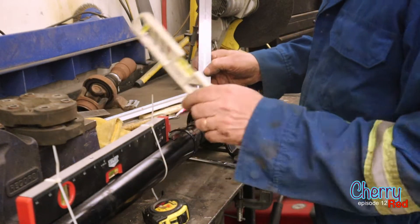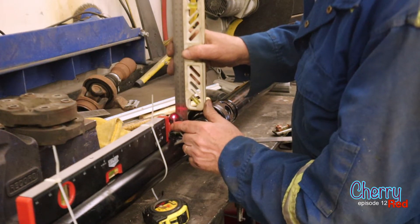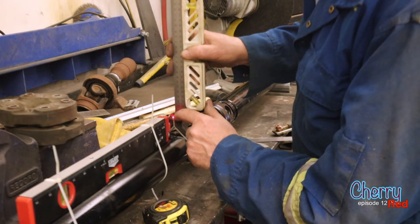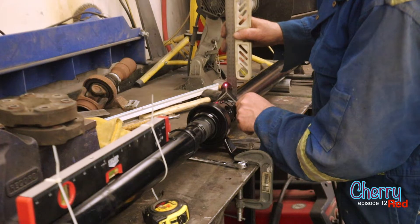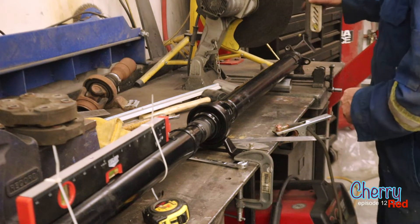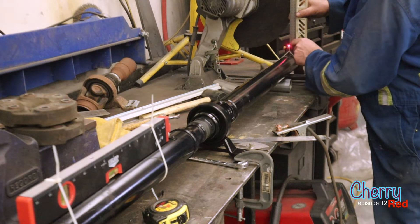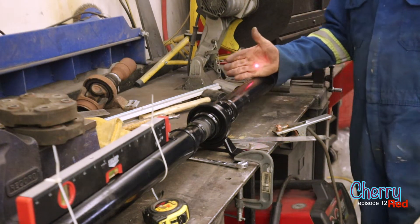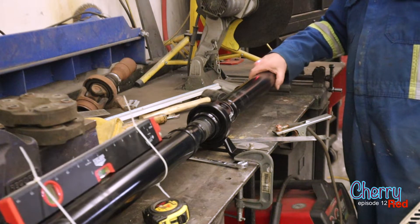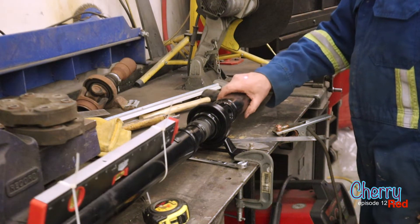With the light on, I use this little V-shape thing and a level. If I get a point where it's straight on the pipe — level on the top bubble, right on that little node — then I go over to this one, do the same thing, level it up and make sure it's right on that little node. Down at this end — the important one — I've wiggled it around until I got it exactly on that little node as well. All that does is give me a straight line through the universal joint, so when I spin it there's not going to be any wobble.